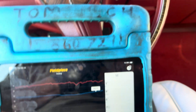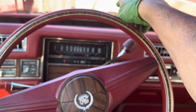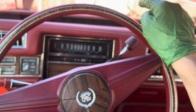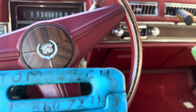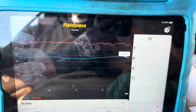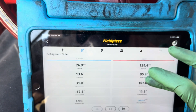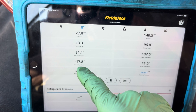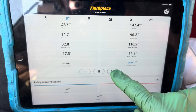I know the thermostat opened up. I bet there's a little bleed-by in the coolant here, or the hot coolant next to the heater core. They have a solid fan — no thermal fan clutch, fixed speed, solid to the engine, no clutch, no thermal fluid. Fixed speed compressor too. These are the ideal situations to do all your tests. We can't use my superheat reading because I'm connected after the VIR assembly, but the subcooling is correct — around 13 degrees subcooling. See how steady that is? That's beautiful.